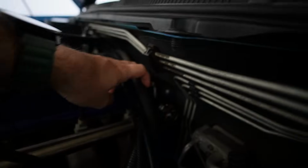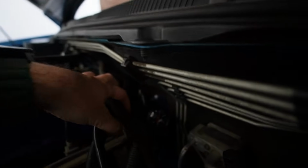Now, the next thing I also did there was I did the FPR compact, which was a disgustingly easy install. Quickly show you guys what that looks like too. So the factory fuel pressure reg actually sits down the very back of the fuel rail right here. See if I can focus that one up for you guys. There we go. So the fuel pressure reg sits down the very back and it is literally held in place by a spring clamp. All you have to do is get a flathead screwdriver, release the spring clamp, and then the fuel pressure reg comes out.